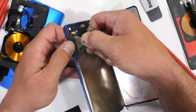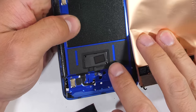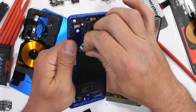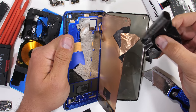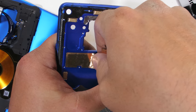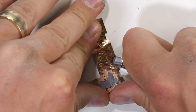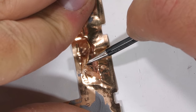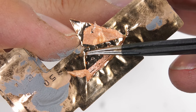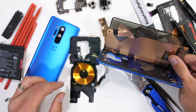Peeling back the 10-bit 120Hz flexible AMOLED display, we get our first look at the rectangular under-screen optical fingerprint scanner. It's in the exact same spot as the haptic vibration motor on the reverse side of the frame. There's also a lot of thick graphite tape which will help with heat dissipation. The copper heat pipe itself is average size, resting between the screen and the frame instead of the motherboard and the frame. Slicing it open, we can indeed see liquid inside, along with the copper wicks that make the whole thing work. I think this is the best looking phone we've been inside of so far this year and definitely worth the teardown.